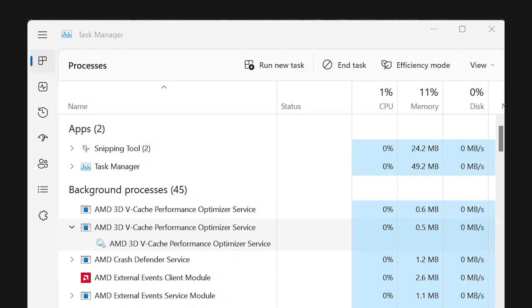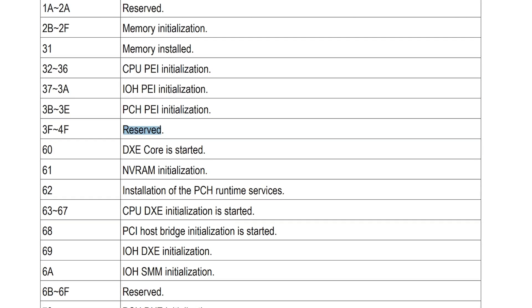We made sure that Xbox Game Bar is on and Windows Gaming Mode is enabled and all of that, but nothing helped. Then we reinstalled the chipset drivers again and again and again, but we did not notice that the two tasks which were supposed to be running once we installed the drivers were present at all. Adding to that, every time I installed those chipset drivers, my motherboard decided it didn't want to work anymore — some error code listed only as 'reserved' and nothing more. Every time I needed to reset the BIOS, go back into BIOS, disable EXPO, boot it up once, boot it down, boot it back up, enable EXPO and boot it completely back up, just to see that the two tasks were still not present.